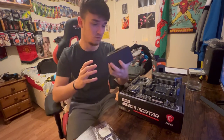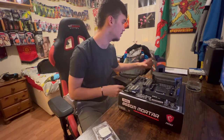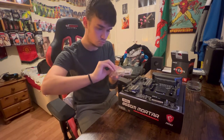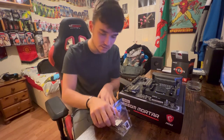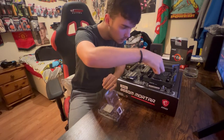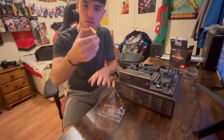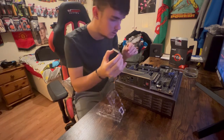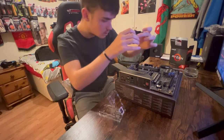If you need to, I'm sure the stock cooler would be fine. I won't be using it, but if you have a bit more of a budget, you won't need it. So let's open this carefully. It's mad how expensive this stuff is and it's very small. Start by lifting the little rod, spin the socket around, then take out the CPU and find the gold triangle. Don't touch the bottom with all the little prongs on it — you don't want to bend any of them.